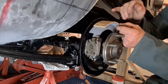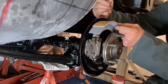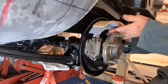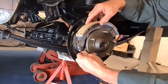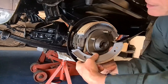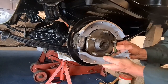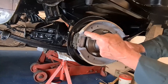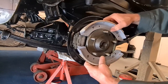Then you wind it out and count how many turns until the other side touches, then wind it back half that number of turns — in theory that should put it dead level with the drum. So I'm going to do that in a minute. If you bring this shoe round as far as you can, you can hold the spring out and it goes on easy like that, then this one goes in there — put this side in first on both shoes.